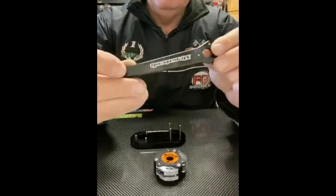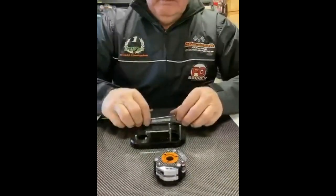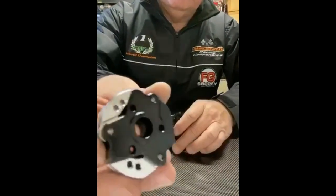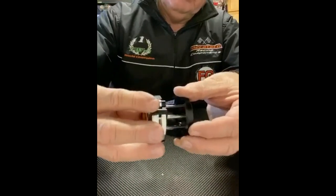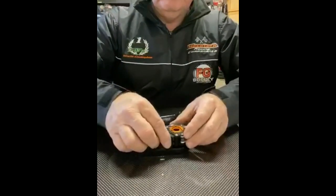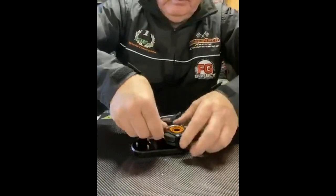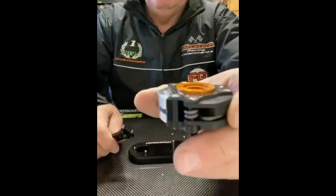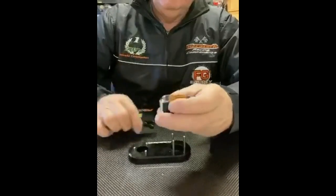To actually make the rotations on the plate, you need a tool like this — similar to other clutches. See those three holes in the back? You're gonna line those with the long pins, set the clutch on the table, and push down. You hear that clicking? That's the plate — it popped up about one eighth of an inch.